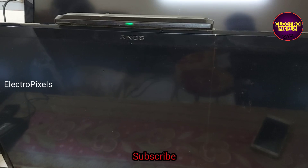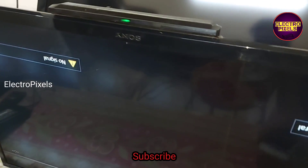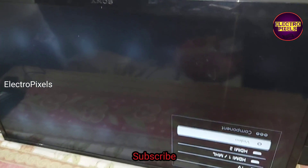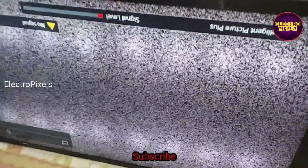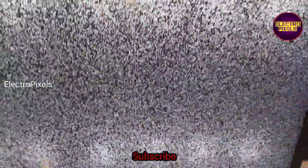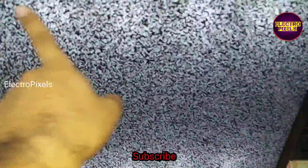In the top and bottom portion of the screen, you can see a white spot issue. Also in the center portion, the display is dark. This means that the middle portion of the LED strip is not working, and that is the reason for the six times blinking issue in this TV.